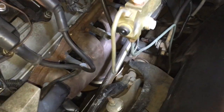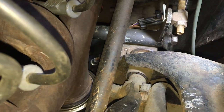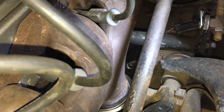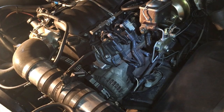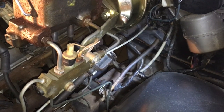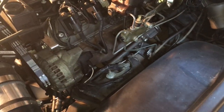On this side of the engine, down right below the steering column, you can see that I have the clutch pedal bracket mounted to the frame. There's the Z-bar, and I made a bracket for the engine because LS engines don't have the bracket to hold the Z-bar. I bought a new ball end for a Z-bar bracket and made a bracket for the side of the motor. So I still have all the mechanical clutch linkage under the hood and up to the clutch pedal — it all works just like the original setup did, and it pushes down on the clutch lever on the side of the bell housing for the Muncie transmission.